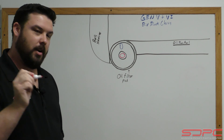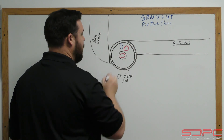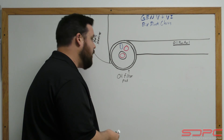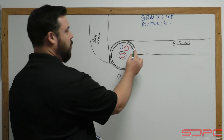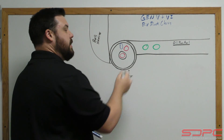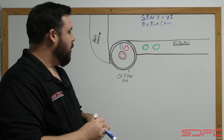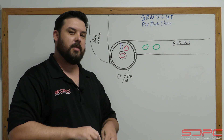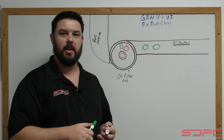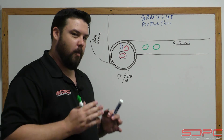Then you might see another valve in another hole — it's right next to this blue one here, a perfect circle hole right there. And you've got a couple more here on the pan rail, where your oil pan would be mounted. You've got two here, and these are 3/8 NPT fittings. I bet you're seeing some low oil pressure at idle — something like 5, 10, maybe 15 psi — especially when it warms up. Maybe after you did a pull you saw that gauge and freaked out, trying to figure out what happened.